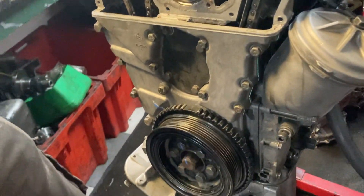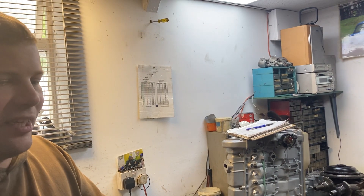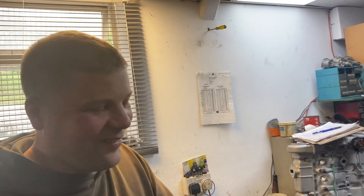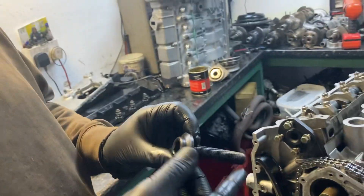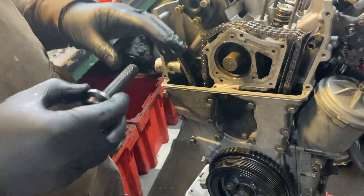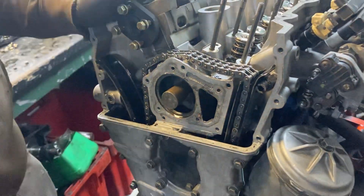What was involved with nosing the crankshaft? The M47 crank is a lot longer - you get a scrap M44 or M42 crank, chop the nose off it, put the M47 crank in the lathe with a steady, and let it into the front as a fit. On the first one I drilled and pinned it - didn't actually weld it - just Loctited it in. Then you drill and tap the crank - I think it's an M14 Audi front hub nut that goes right the way through into the crank. When you tighten it, it holds the nose up against where you've made it to sit, so it's all drawn in from the back. It's got the timing wheel on there as well - it plots up fine and been no problem.